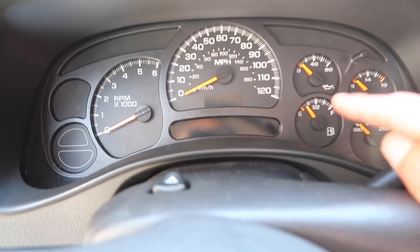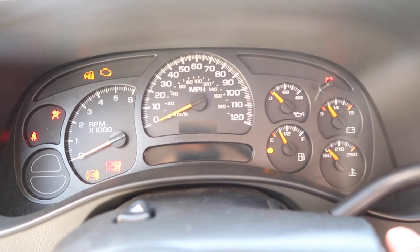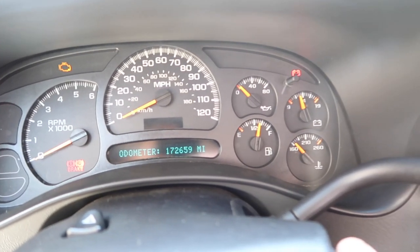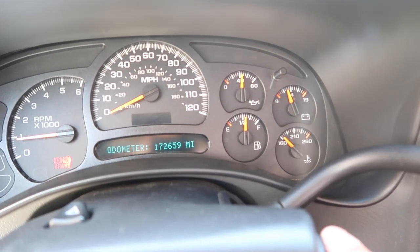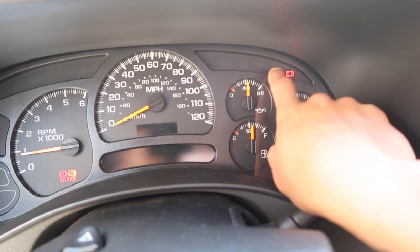Okay, I got the car unlocked. Let me show you what the problem is before I do anything else. What would happen is none of the gauges would light up, and right up here would have a battery light saying 'battery not charging.' Let's see if it does it - oh yeah, there you go, see? Battery not charging and then the light comes on.